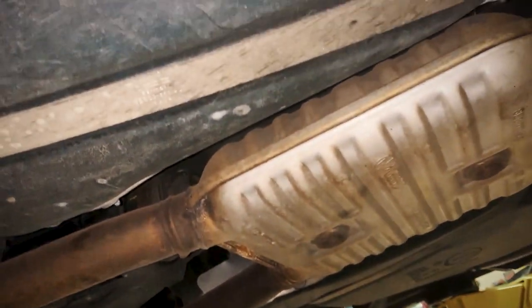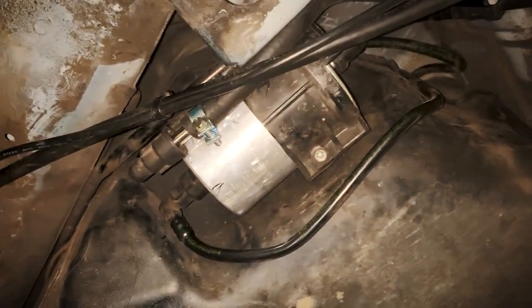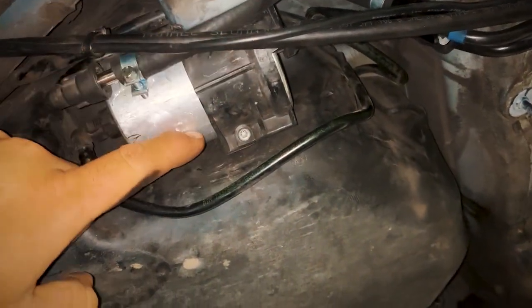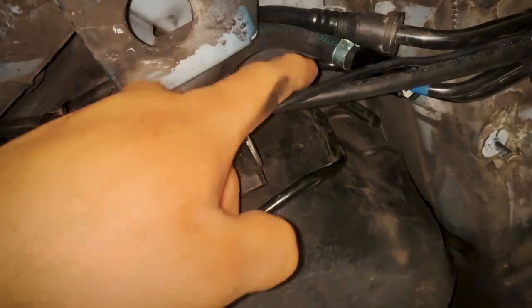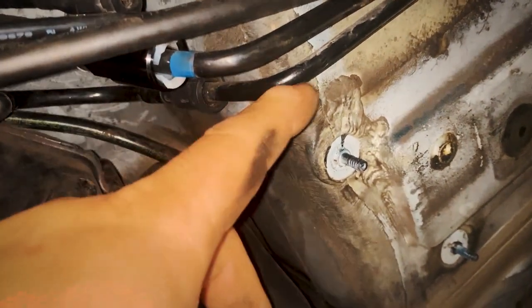You want to run it to this blue line because this blue line feeds fuel to your second side — it's like a double fuel tank, otherwise you'll never have a full tank from what I was told. I also installed the Walbro 450 because the Bosch didn't fit inside it. This fuel filter is from a 3-liter — the main pressure line from the tank goes on one side and this is the one that goes to the fuel rail. Remember: the blue is return and the solid one is pressure.